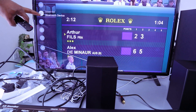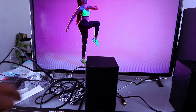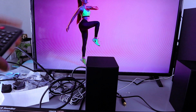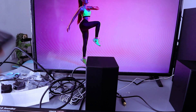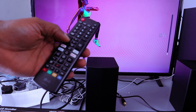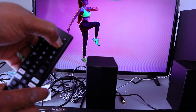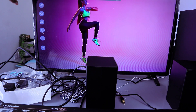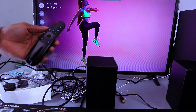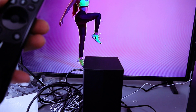Once you select the sound out, it is showing 'Bluetooth device.' Using the TV remote, select TV settings, scroll down to Sound Mode. When it's in Bluetooth, you need to use the soundbar's mode button to select the sound mode, such as Music.